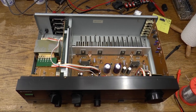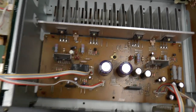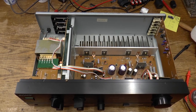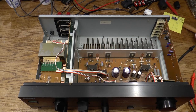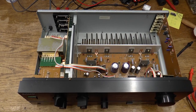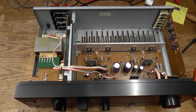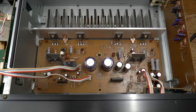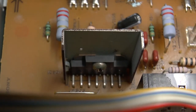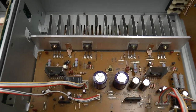We got a green light and the speaker relay clicked. This does once again show a very typical problem with Sony equipment of that age — amplifiers in particular — and that is bad solder joints. No matter what happens, I will be taking this main circuit board out because another very common failure point are these driver ICs, these integrated driver stages. Those develop bad solder joints and when they do, all sorts of terrible things happen in the amplifier.